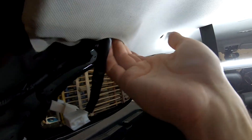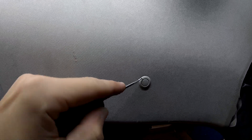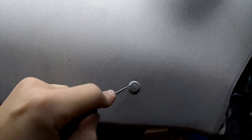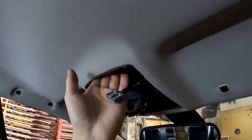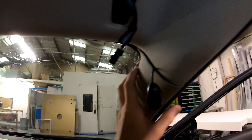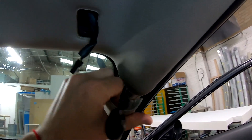See, the middle light is gone — it should be on. This connector goes to the middle light; this is how you get to it. I'm laying down right now. You can see the headliner itself — the panel is off. Now we have three tabs here; try not to damage anything. You can just peel this off and slide it upwards a bit — see, it slides up and down.